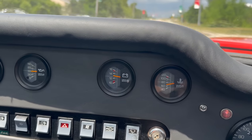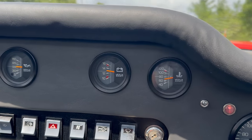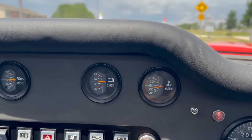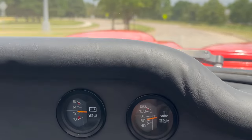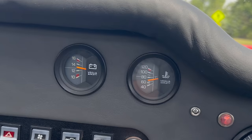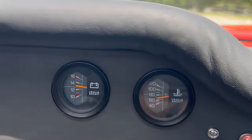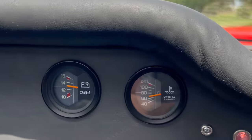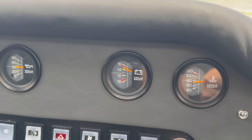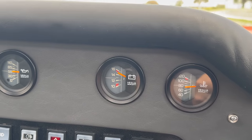It's been a couple of minutes, and it's doing it again now. Everything seems to be fine now — and now it's not. Although it seems to be having the problem a lot less regularly than it used to. And now it's doing it again, trying to charge over 16 volts and really bogging down the belt drive.